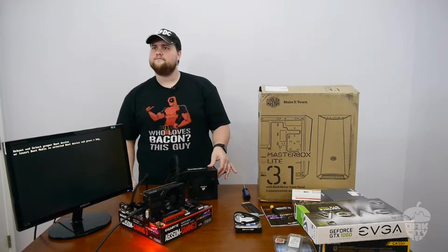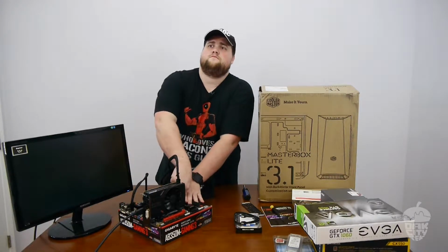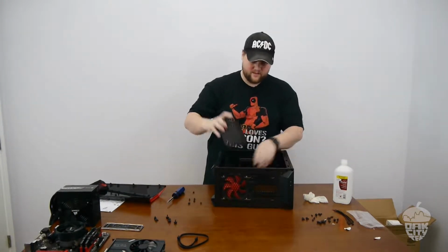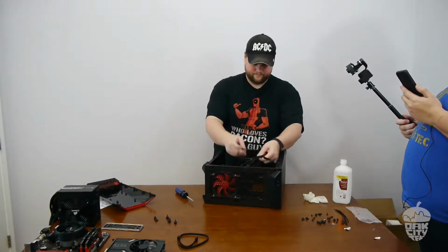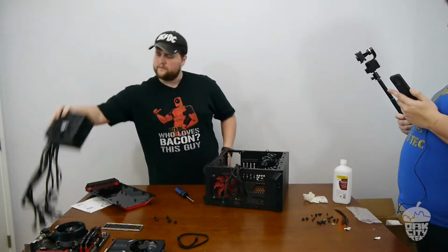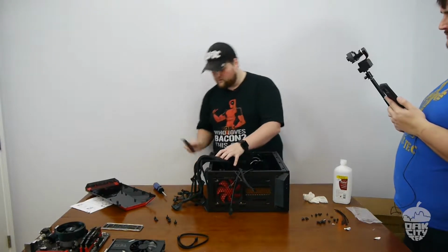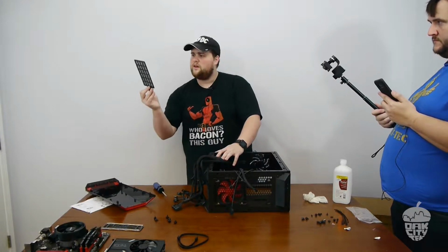Need a boot device. Done. Check. So now our next step is to put it all in the case and rock and roll. Alright. This case is very light. What are those, the case cables? Yep. Then mount the power supply. Alright, so the fan for the power supply is mounted down because there's a nice air filter right here. So like once a year or something, pull this off, blow it out.